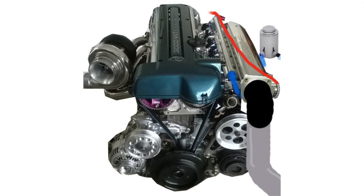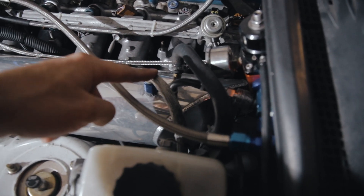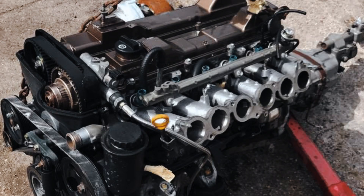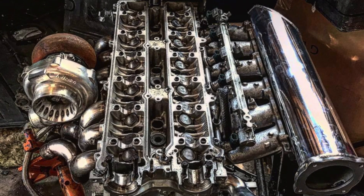Next was the 3.5-inch 90-degree coupler, and I trimmed all the intercooler piping to fit the new intake manifold. I drilled three holes in the intake manifold: one for the brake booster, one for the boost gauge, and one for a sensor for my ECU. Installing the intake manifold on the engine is pretty self-explanatory — if you remove the old one, it basically slides in place of it. You have to thread all the nuts from inside the intake manifold. I used a little bit of RTV to make sure there's a tight seal.